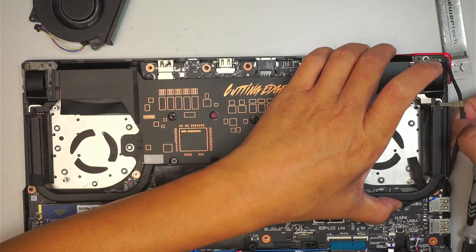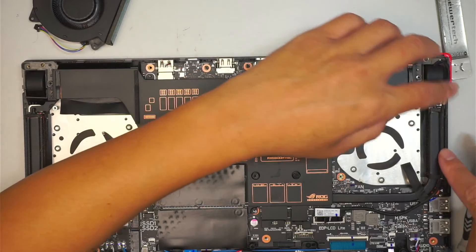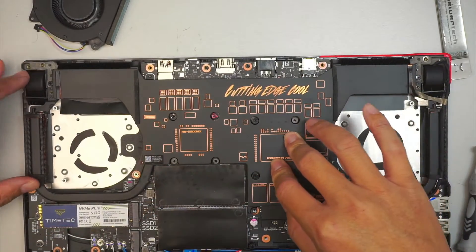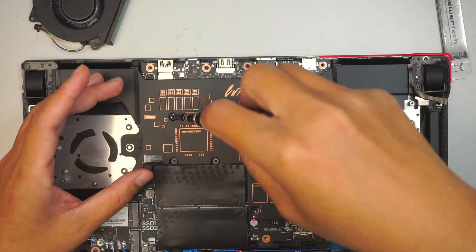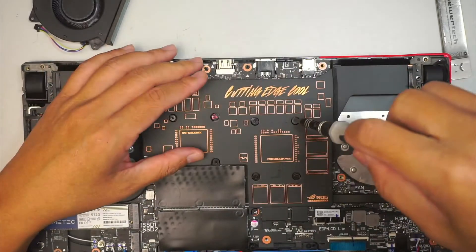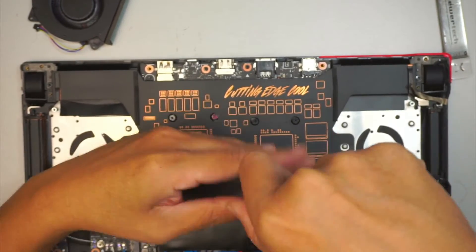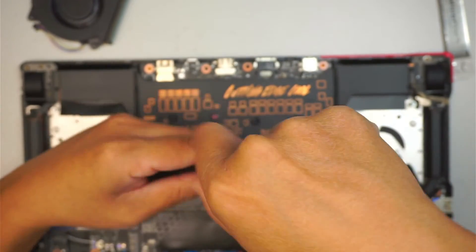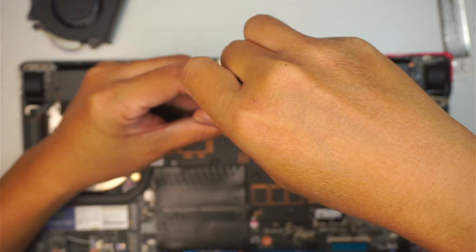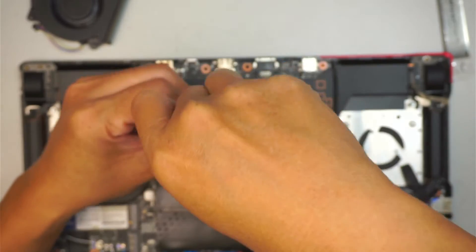Make sure this cable is going to sit on top of the heat sink, not below. That is the gap where you put it in — make sure it matches all the screw holes. I'm going to put the first screw in and turn just a little at a time. That way when you press the heat sink down, the thermal paste doesn't squeeze all to one side. Turn two or three turns on each screw, then come back and finish, so it sits flush and straight.